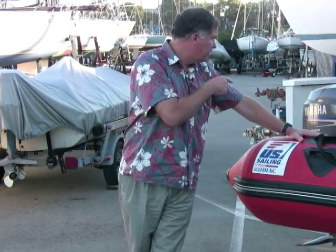When we first put this boat into operation at the Yacht Club, we had some problems with it, and we've come up with two really nice solutions. The boat is fine and the little Yamaha outboard is fantastic, but because we mounted the console pretty far aft, we had difficulty getting the boat up on a plane. The bow would rise and it wasn't very comfortable.